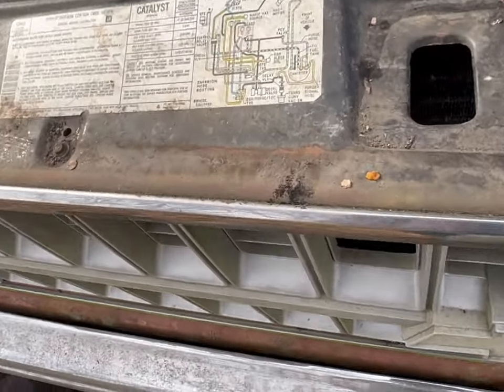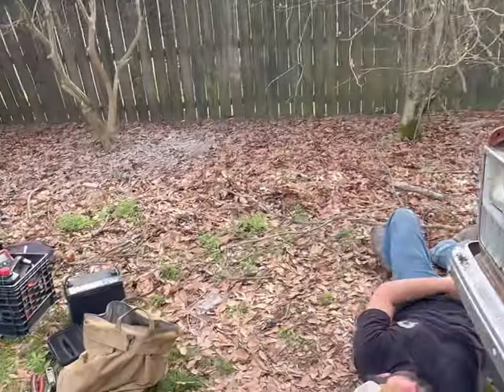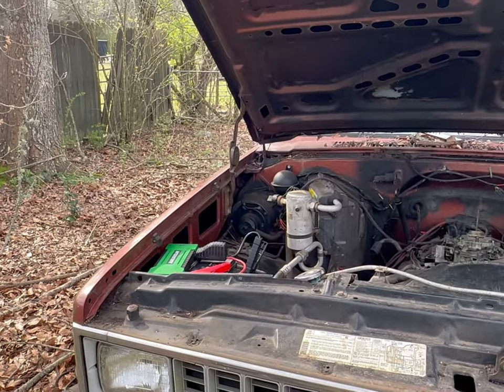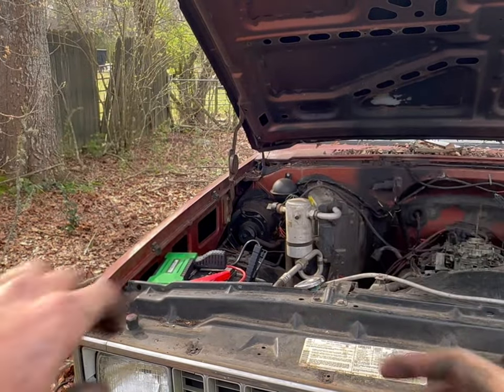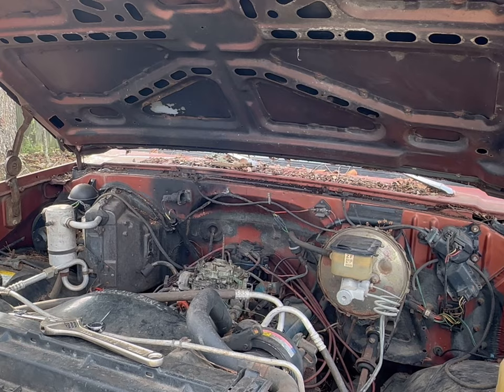Okay. How much hose you got? Not much. Hand me that can. Well, hold on a second. Let me set this up again. I'm gonna dump some down it first and have you turn it over. That way it'll get the diaphragm and the pump wet. Okay, we can try it. We'll just try that first. If it won't start sucking right away, we can try something else, depending on whether the diaphragm's sopping or completely dry.